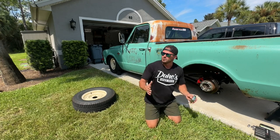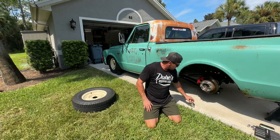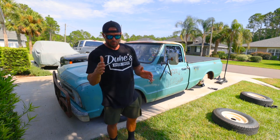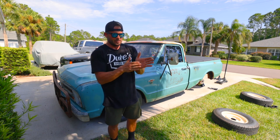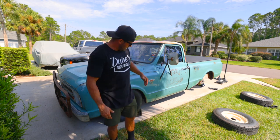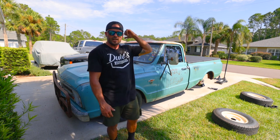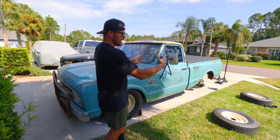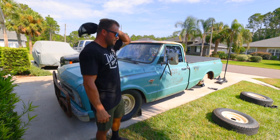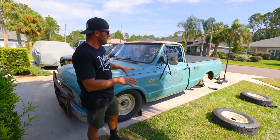That's why it's constantly wanting to turn — if the rear axle's turned, then it's pushing. Something is tweaked on this truck. The rear axle's outside of the rotor is 12 and a half inches from the outside of the frame on both sides, but the hub-to-hub is 115 and seven eighths on this side and 114 and three quarters on the other side. So the truck's almost like a banana, which is why it kind of wants to float around into one side. And when I do burnouts, the back end kicks out to one side — I can't keep it straight.